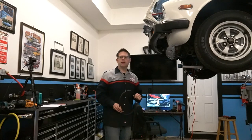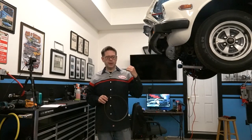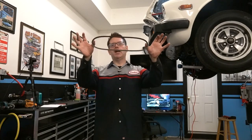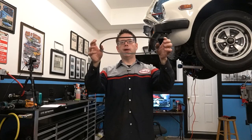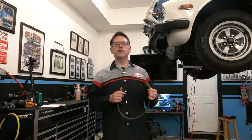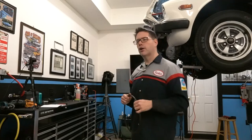Today we're going to show you some tips and tricks on how to tighten V-belts properly using specs found in the service manual, starting with the alternator belt. There is a basic premise for V-belt tightening: look at the span of the belt — from the middle of one pulley to the other — and take that measurement in inches and divide it by 64. That's usually the rule of thumb for V-belts, though you'll still want to check your service manual.